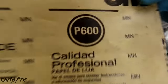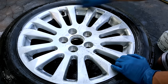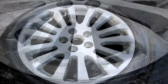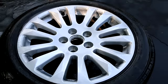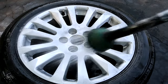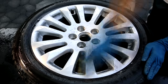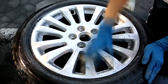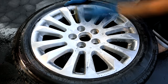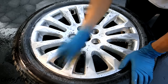After the 400-grit, move to 600-grit. With the 600-grit, you should just be smoothing down the 400-grit scratches. The 600-grit won't remove deeper scratches, so if you see any, go back with your 400-grit. Now go from 600-grit to 1,000-grit — as you use the 1,000-grit, you should see the scratches disappear and the surface start getting a little shiny. After 1,000-grit, move to the final grit: 2,000. With the 2,000-grit, the surface should feel really smooth, the sandpaper should slide easily, and you'll notice the rim getting shiny with no visible scratches. Any scratches you missed can be fixed by going back to 400-grit and working back up to 2,000-grit — you only have to do that in the area you missed.